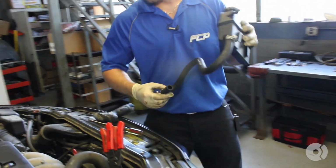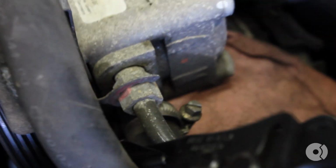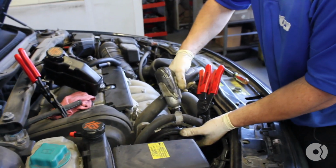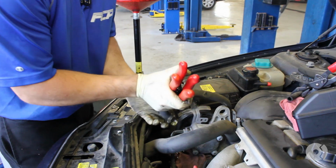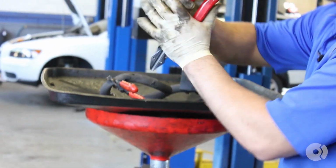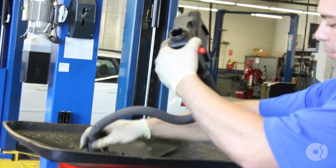If you come over here, you can see, if you come over this way and you position the clamp exactly how it is, you're going to have easy access to tighten it. So make sure you position it that way. Alright, so go ahead and loosen. When you take it off, as soon as it pops off, take your finger, plug the hole. Lift the whole unit off. Discard it. At this point you can take pinch off pliers. Open up the cap. Drain all that fluid out.